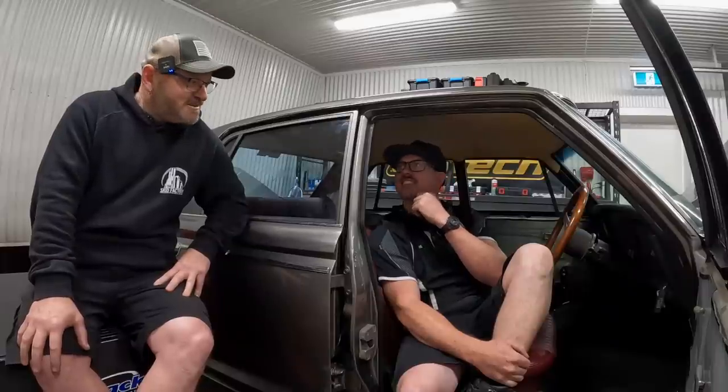Yeah, you made your prediction straight up, Kai. Yeah, well, Al messaged me with some of the stuff, and I said I thought we'd probably be out of fuel system straight away, and we are. We just gave it a little run, just to let the converter catch the engine and see where it was going to roll over, and even there we were at 105% duty cycle, so the injectors were fully open.